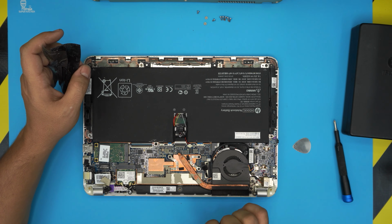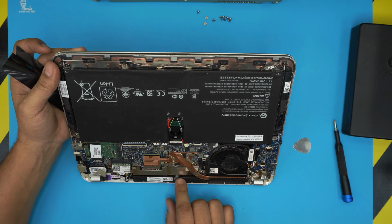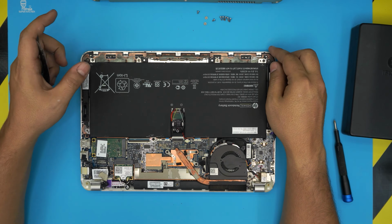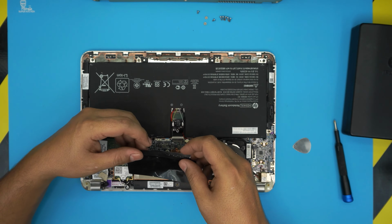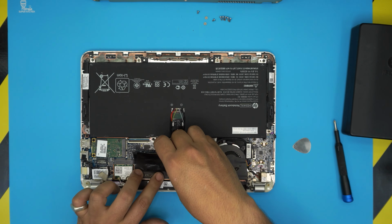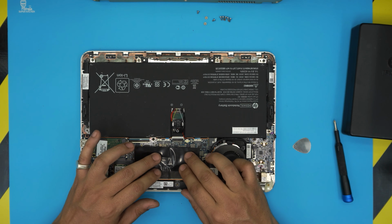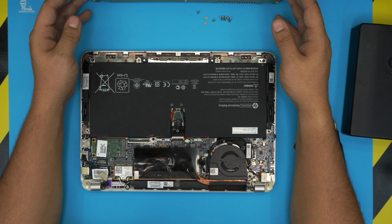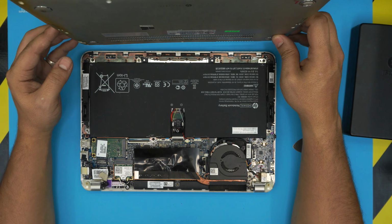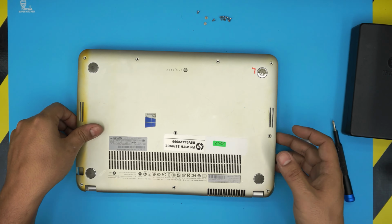You have an SSD drive, but unfortunately, firsthand, you can see that the RAM is not exposed or available to replace. So we're going to cut this video really short and put it back together. This is for those people that keep asking me why they cannot upgrade the RAM, even if their task manager shows 1 out of 2 slots available. In reality, there are no RAM DIMMs available on this motherboard. Windows will always tell you that there is some DIMM available.